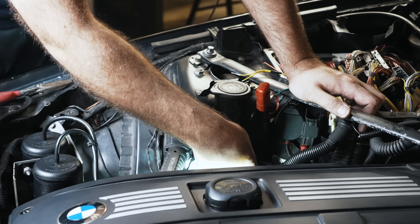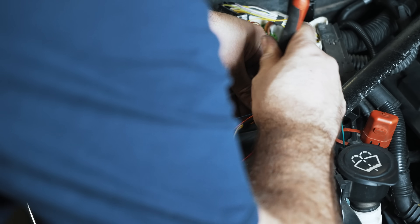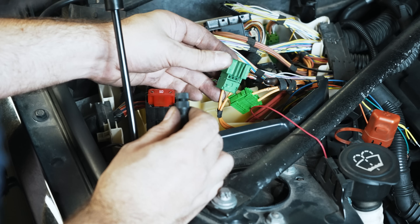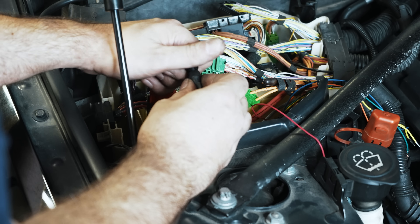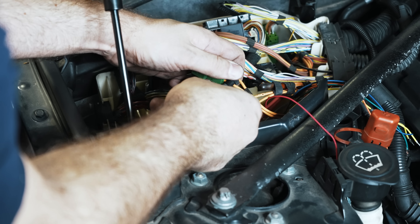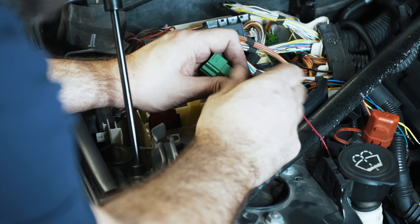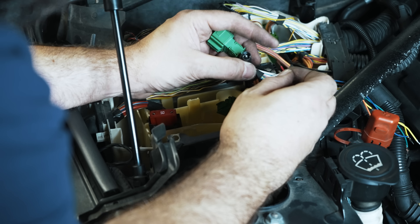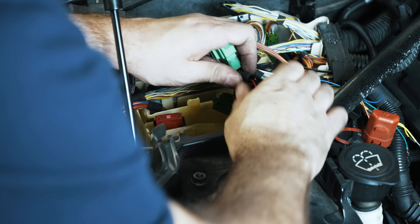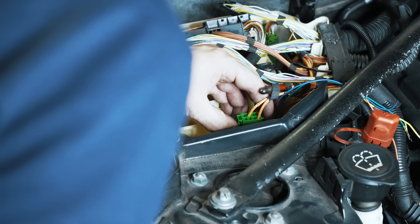Right beside your washer fluid fill there's a 10mm bolt for ground — put the loop through there. There's a green connector clipped into the box; I extracted it so we can take power from it. Take the supplied tab connector, orient it so the pin will pierce the wire, strip back some of the wire, fray it out a little for good contact all around, and screw it in. We now have a good positive connection — route it back onto the DME box. Power is taken care of.